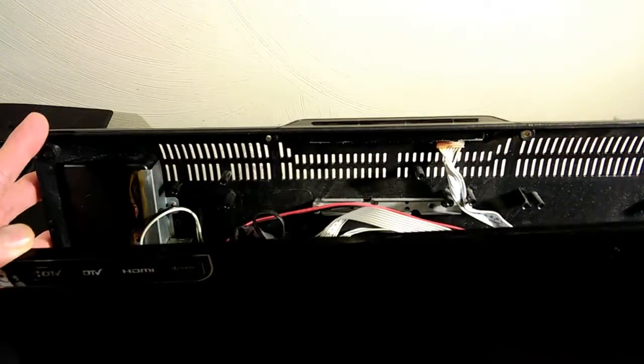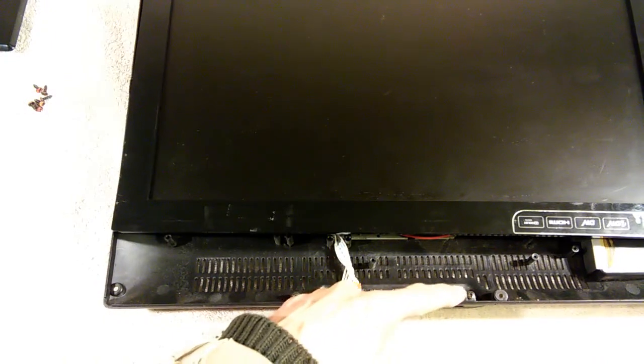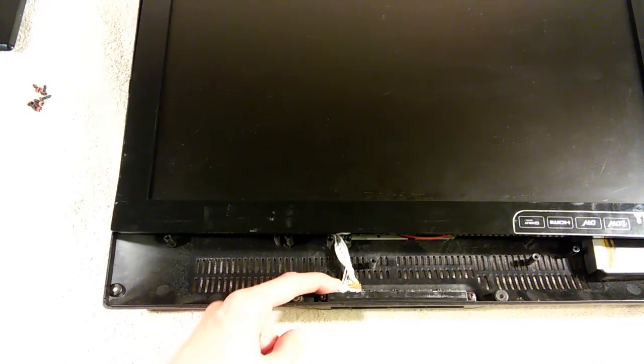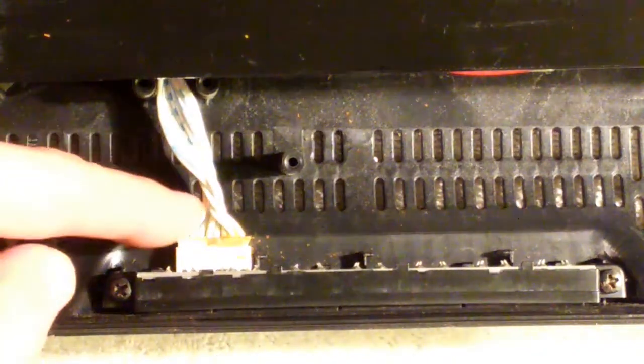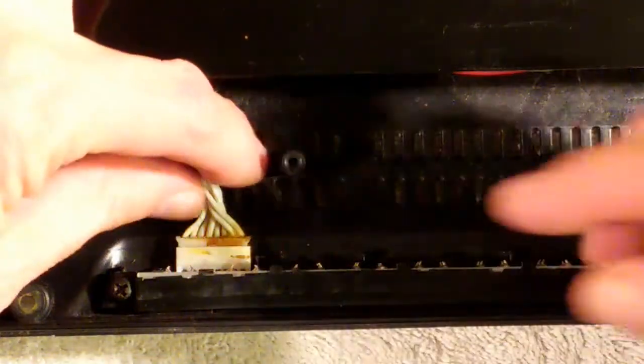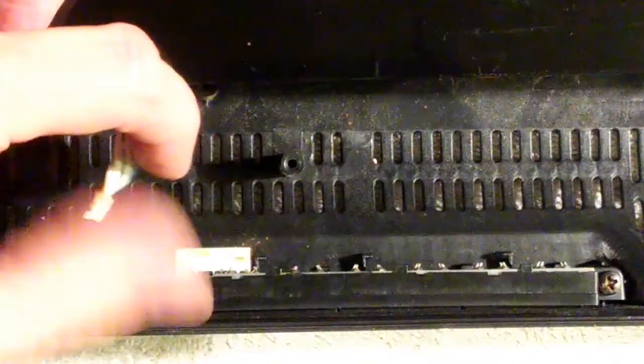Looking inside, we do have quite a few cables connecting the front to the back. We don't have to be really concerned about those — the only one we're concerned about is the one connecting the buttons. We have a single connector. Putting it upside down, we expose the button board and this one cable supplying it. Here's our button board and here's the cable from the rest of the TV. Out comes that connector.